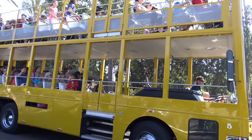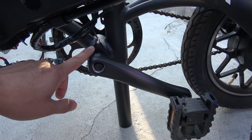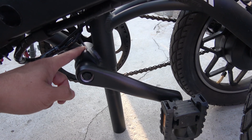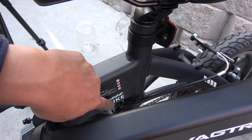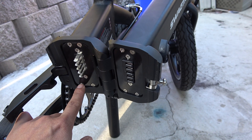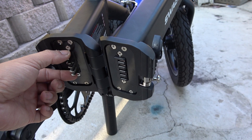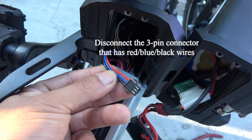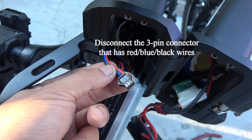I was lucky this thing pushed me into a bush and not under a bus — otherwise I wouldn't be here reviewing this bike. So the very first thing when I came home was to figure out how to disable the pedal assist mode. On this bike, pedal assist is always on and gives you no option to disable it. So I had to do it the old-fashioned way: fold the bike in half, remove the four screws that hold the connector, pull out the controller, and unplug the cable that leads to the pedal assist sensor on the crankshaft. And voilà — you've disabled the pedal assist mode.